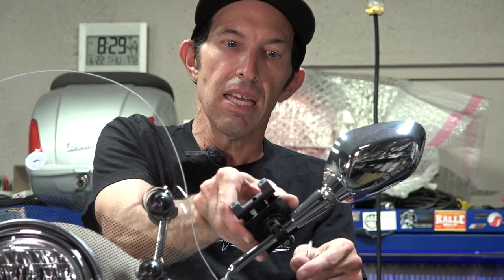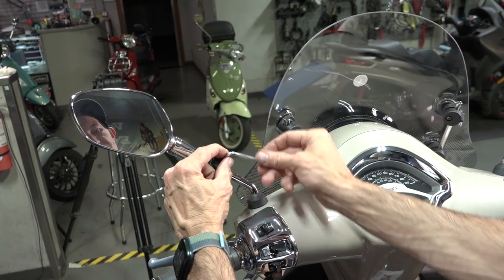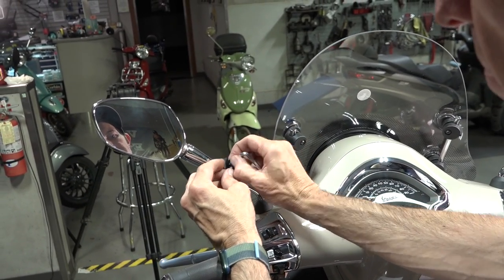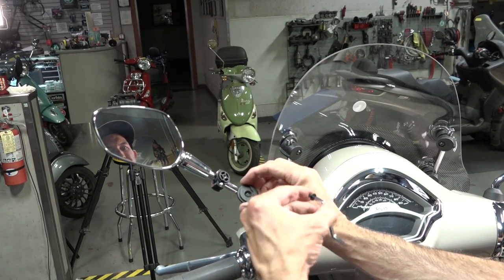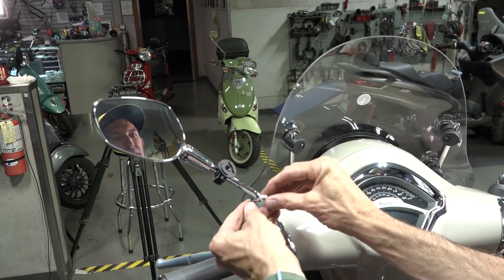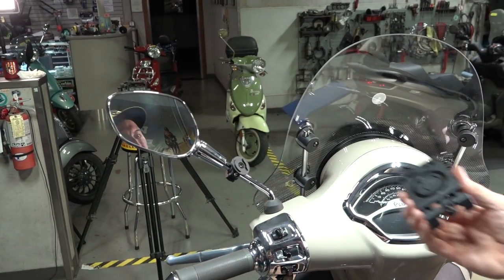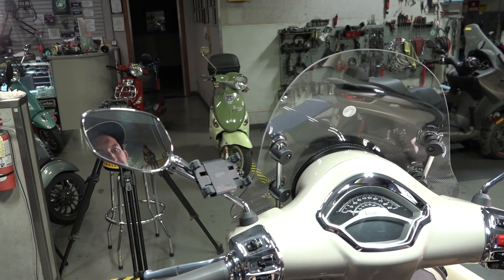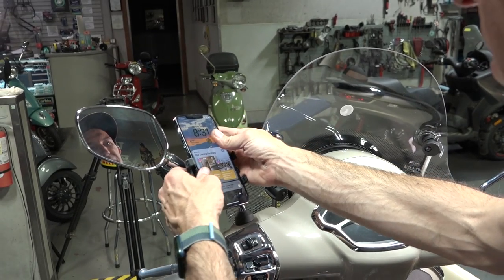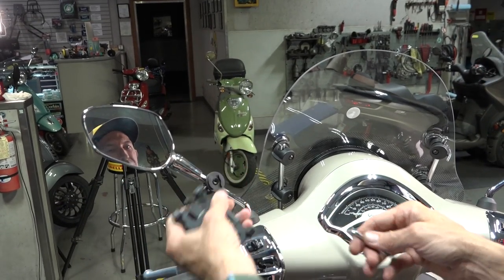You see this little button on the back — you twist it on. It's at a weird angle, so I want to reposition it. I'll remove this center fastener — make sure you don't lose that little grub screw. It's on a spline underneath, so I'll set the slot at approximately the angle I want the phone. Let's give that a shot. I'll reposition it, crank it down, snap the phone right in. I'll test with my phone and rotate it a little bit toward myself. That's pretty ideal — I like that setup.